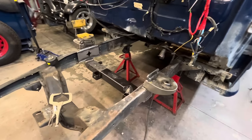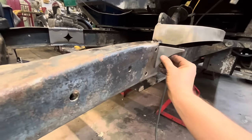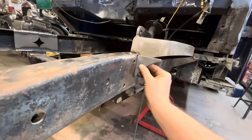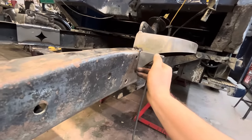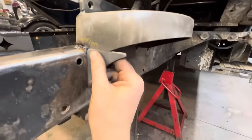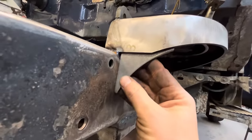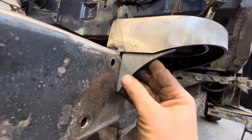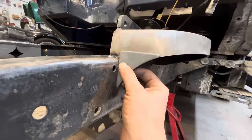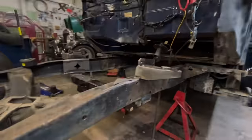Okay, our hats are fully welded on. So tomorrow morning, we've got these gussets that are supposed to go in here. So I'm gonna think overnight if I'm going to trim these gussets down and weld them flush to that, or should we lap them? That might be a bit stronger. We could lap it that way, or we could lap it on this side. I'm gonna think on that overnight. Come back to it tomorrow morning.